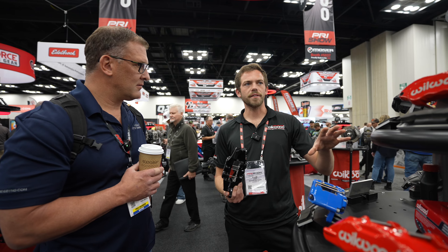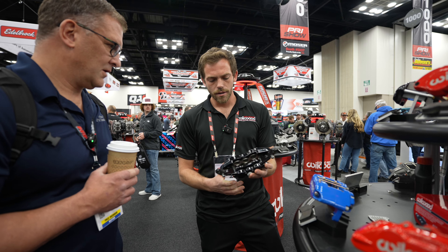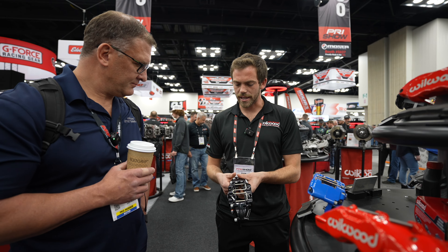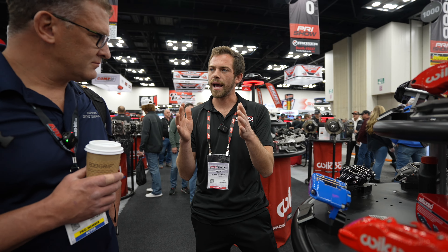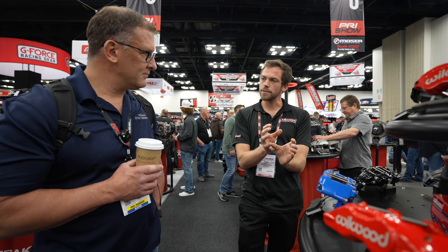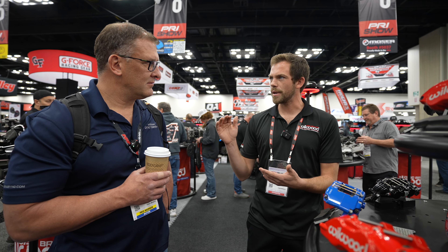Wilwood is offering a full brake kit with a caliper specifically designed for the UTV market with wide mount centers for easy bracketry. We're going from a factory single-piston floating, a two-piston, or on some turbo cars a factory floating three-piston caliper, over to a fixed-mount six-piston caliper with a W-clip top pad retention design. With a fixed-mount caliper, you have a lot less compliance — instead of the piston pushing out and pulling the caliper back, which leads to a softer, longer pedal sensation, a fixed-mount caliper just generates pressure, transmitting into a higher, stiffer, more performance-oriented pedal feel that gives you confidence to really lay into the system.